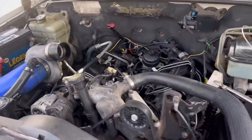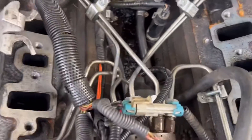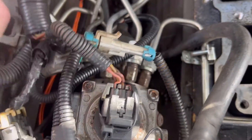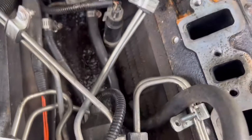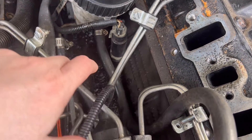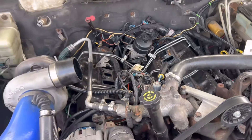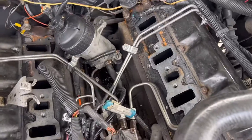I killed the engine so I can hear myself think. I have a bit of diesel coming back from the valley, but I'm struggling to still see where it's coming from. The hard return line here was not appearing to be leaking and it's starting up here towards the injector line. I'm going to go ahead and bust out my trusty wrench and check all my high pressure lines, then check my injector nuts on the outside. All eight injector lines are re-tightened - nothing looked too bad.